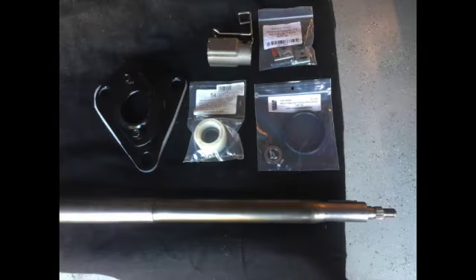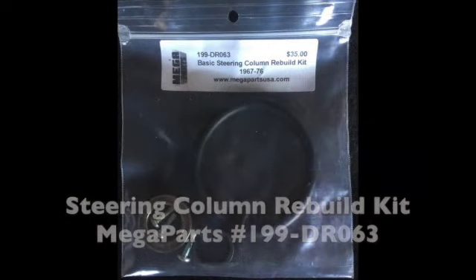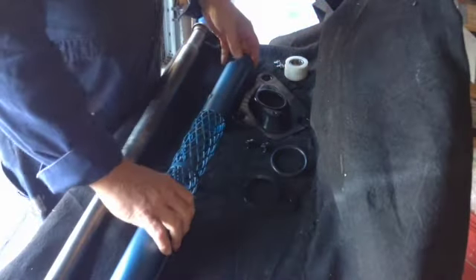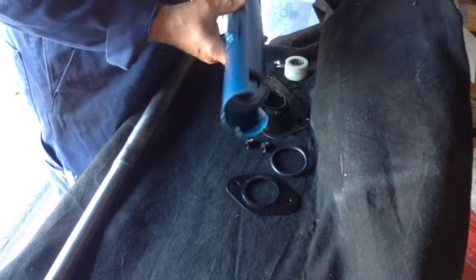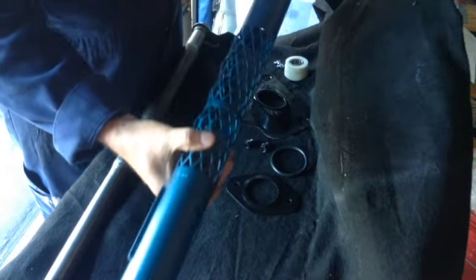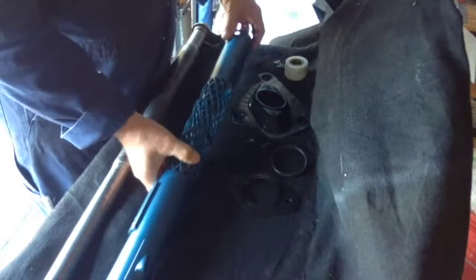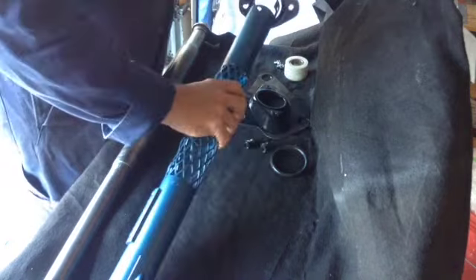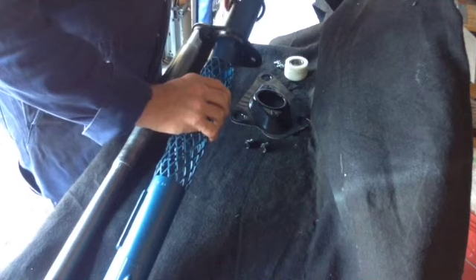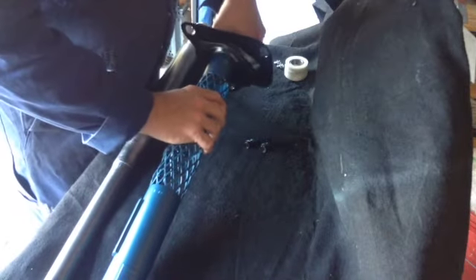Here are the parts needed to begin the assembly of the far end of the steering shaft column. Be sure to apply a thin coat of multi-purpose grease to all friction surfaces. This end goes toward the steering wheel, and this end goes toward the steering box. Put on the O-ring retainer, the rubber O-ring grommet, and the floor plate before inserting the shift tube and lever. The O-ring is for moisture, smoke, and air prevention. Bolt on the O-ring retainer.